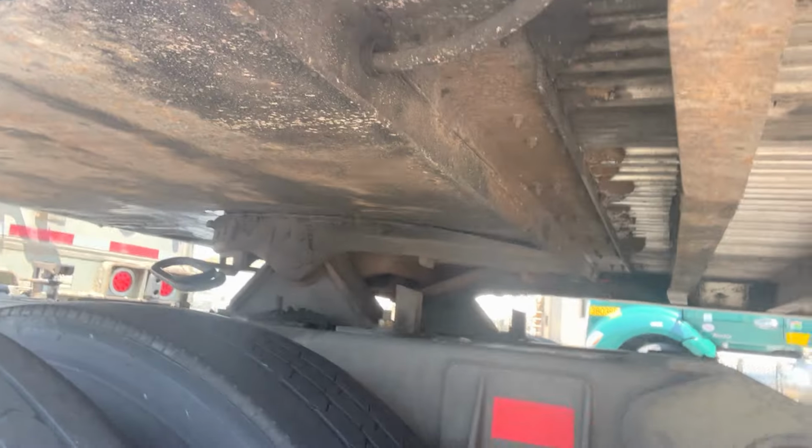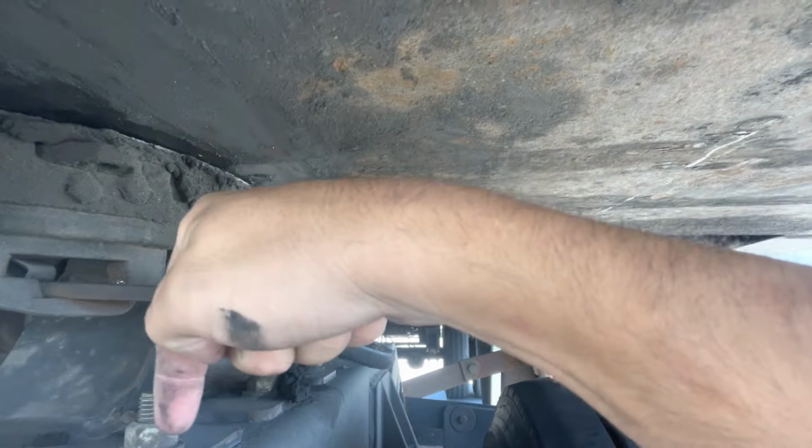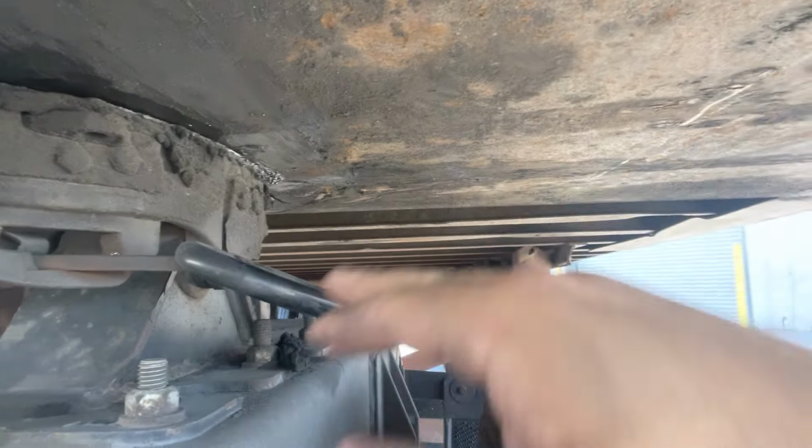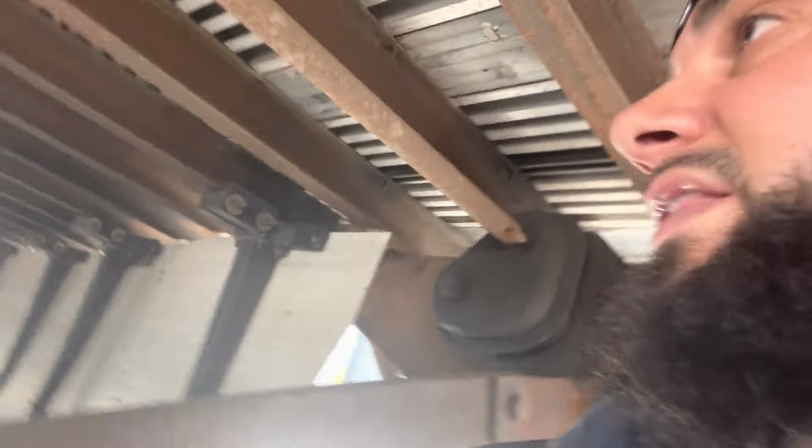The first sign is that that arm is in position, which is all the way to the right, all the way to the right, and down. If it's up here or sticking out, that's a huge no-no. Locking jaws are all the way around the kingpin. All right, my underbelly's good. I already inspected that before. All my cross members are good. All my moving parts are good.